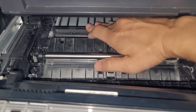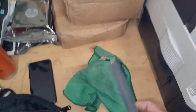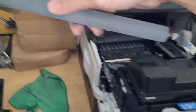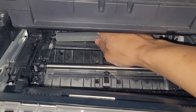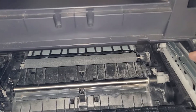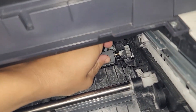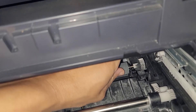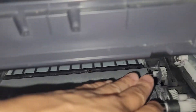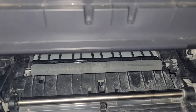Once you know it's fully snapped in place, you can get your brand new transfer roller. Make sure the edges are clean — if there's any toner on the metal or on the plastic guides, it will squeak. Slide it in on the left-hand side first, and on the right-hand side lay it right on the collar. I'm actually on the wrong spot here — this happens quite often. You'll see I press down and nothing's going to happen, because I was just off. So just move it slightly back, make sure you're right on the collar, and then it'll snap in place.